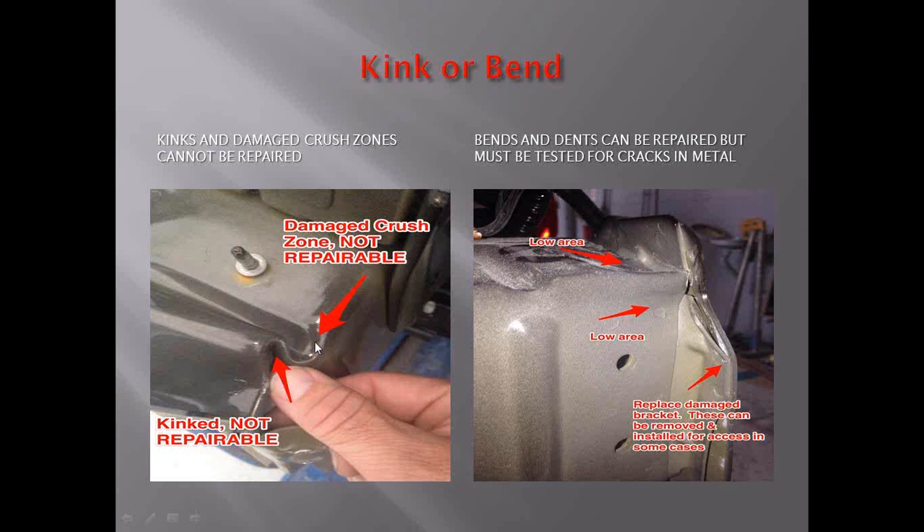This is the safety part of the vehicle. The other rail on this vehicle has some pretty minor damage — just pulled in a little bit in two spots. You need to follow your manufacturer's suggested repair techniques. Some parts are spot-welded and can be removed to access and repair the area, then new outer parts installed. You really have to look at your OEM guidelines for that — check with your OEM.